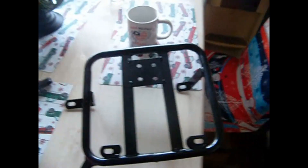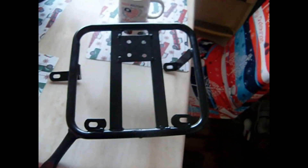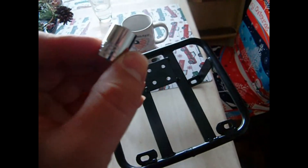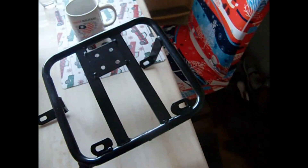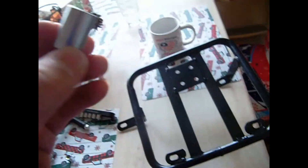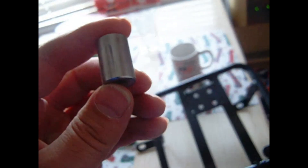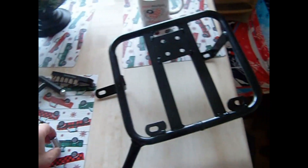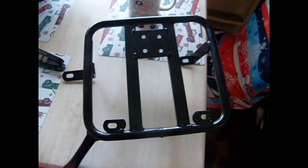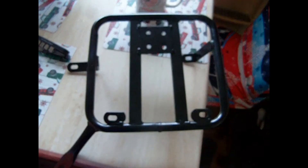So for this — this is the driver's side portion of the racks — we're going to mount this basically just like this. For this you're going to need either a 15/32 socket, or a probably easier-to-find 12 millimeter socket. I'm going to go ahead and get that mounted up, and at the end of the video we'll go ahead and do a tool list of what you're going to need to put this on there.